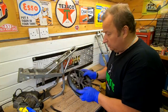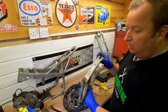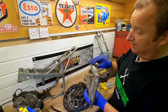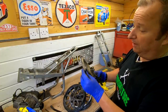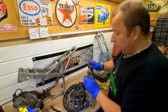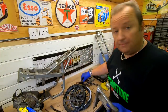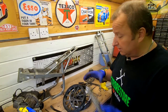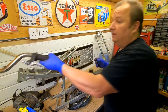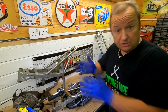So there's no reason why I can't powder coat them now. Also the swinging arm as well, get that prepared as well. And as I say, if this is powder coated, I will probably have to put some paint stripper on there as well. There are no bearings on this bolt going through there. It's literally just a bolt. And all the bolts which I'm taking off, I should be able to reuse, because I'll soak these in MC51 rust converter, and then I'll put them in my tumbler. I've got a rock tumbler which cleans up all the bolts. So anyway, that's a few bits for me to be getting on with. I'll strip the handlebars down as well and get them ready for powder coating. So that's my little job for the moment. So I'm going to do some sandblasting now, so I'll see you in a minute.